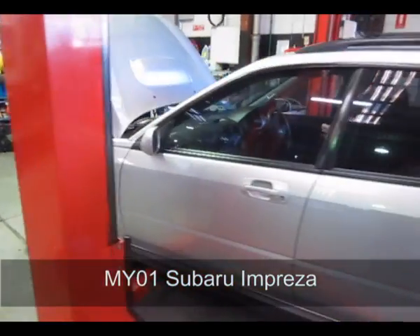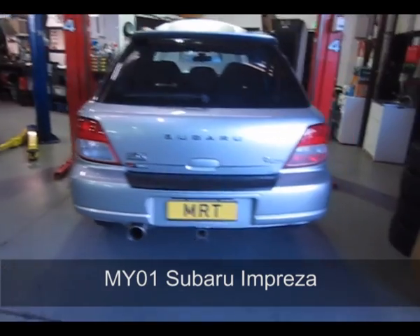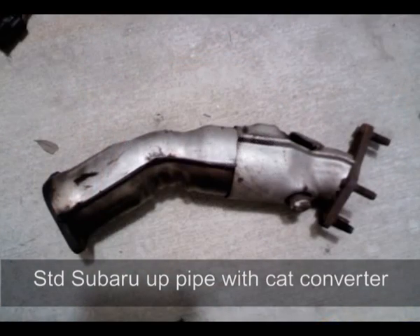It was a 2-litre engine with a revised electronic ECU, and catalytic converters were all different — basically a big shake-up. This was one of the first models on sale in the US, which brought a lot of demand worldwide. Along the way there were some mistakes the aftermarket tuning industry learned about. The catalytic converter in the up-pipe, visible in this photo, was only on the 01 and 02 models — later deleted because when they fail, they cause complete failure of not only the catalytic converter but the turbo as well.